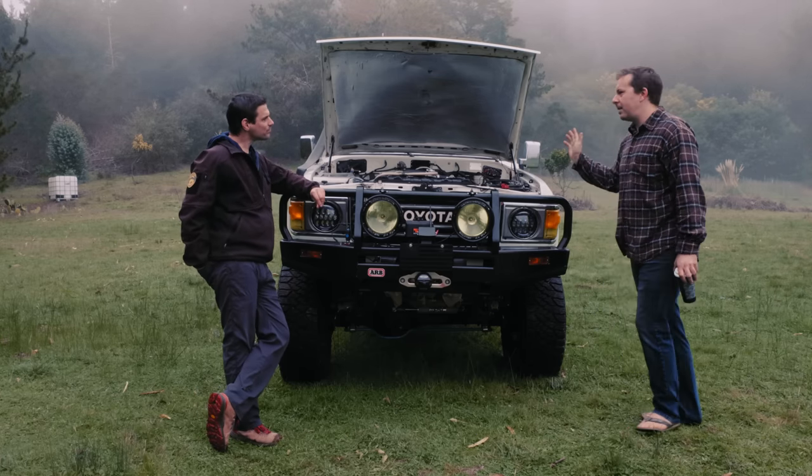The sliders are All-Pro. They'll support the full weight of the vehicle — we use the hi-lift jack on them. We've had it turtled on rocks and it just sits there and teeters. For those just getting started: they're called sliders because you can rest the side of your vehicle on rocks and slide down with no damage except scraping on the slider itself, which we don't care about. Rock lights are the cheapest eBay LEDs — you break them, so no reason to get nice ones.